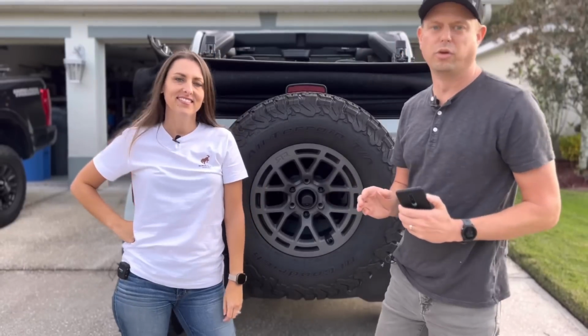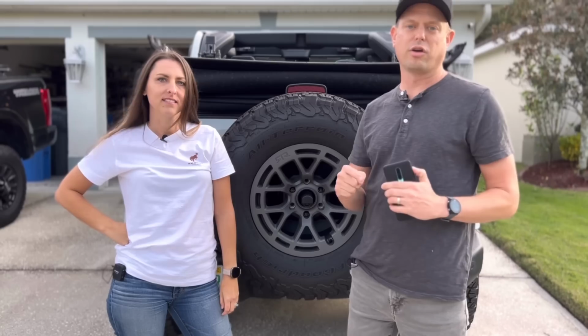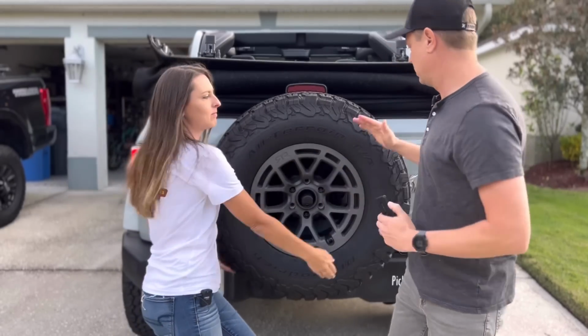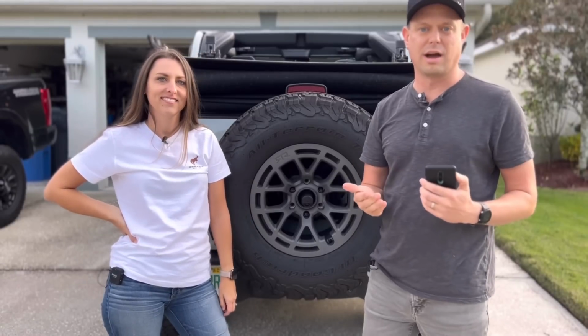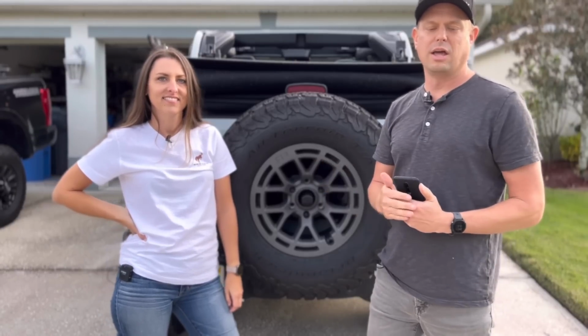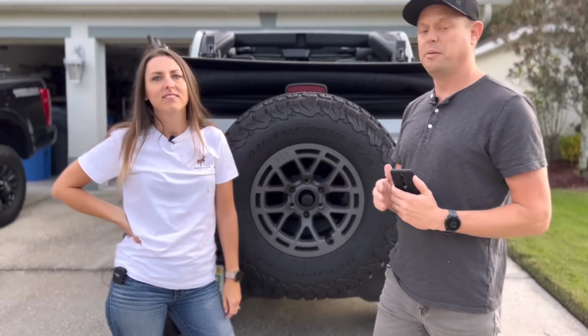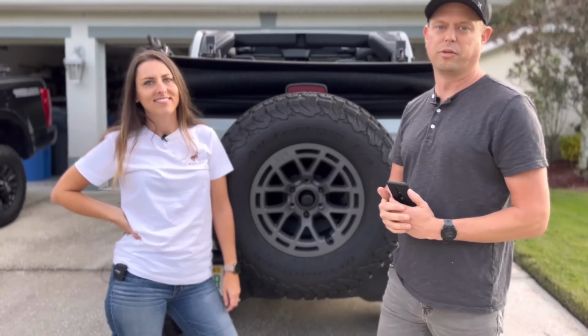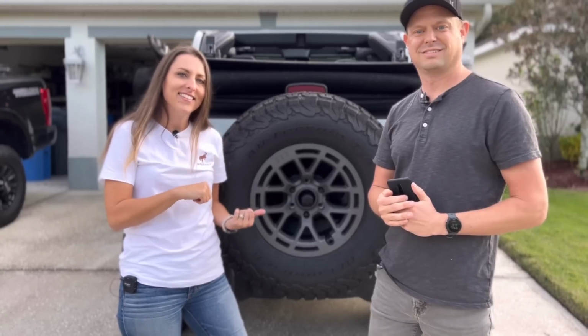One of the things you're going to want to do when you go to access FORScan to recalibrate your speedometer is figure out the circumference of your tire in millimeters. So to do that, what I've done is go to a reference website like TireSize.com, and you can actually key in your exact tire size from your tire, and it will tell you the circumference of the tire itself in millimeters, so you can go into FORScan and put the proper number in. So now that you know what we're going to be doing, let's go ahead and get inside and start working with FORScan.